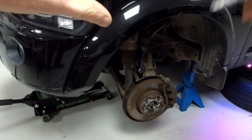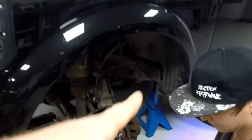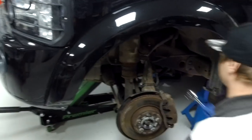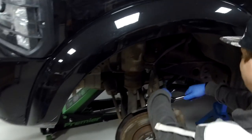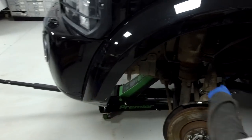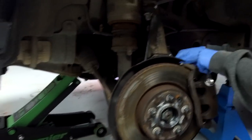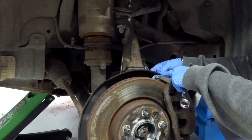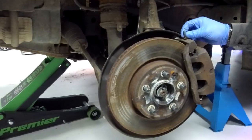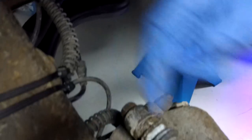We've jacked the car up and raised the suspension into off-road mode, which gives you a little bit more clearance when you jack it up. We have axle stands underneath - we're trying not to crush Ian. We had the inspector come out and check our brand new trolley jack. Health and safety sorted. Right, so what size spanner have you got? You'll need a 13 millimetre socket and a 17 millimetre spanner to take your two slider bolts out that attach the caliper to the carrier.